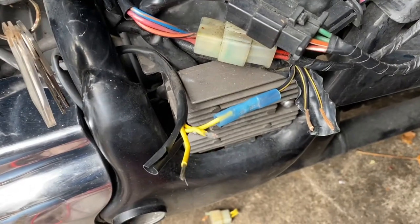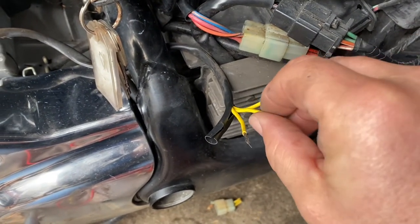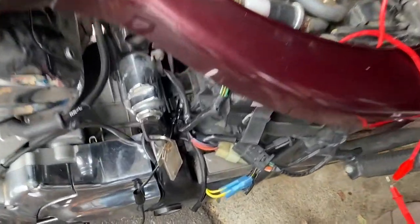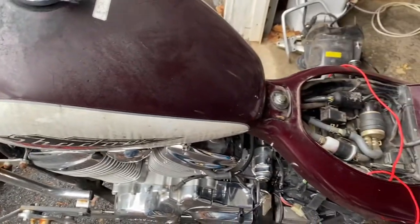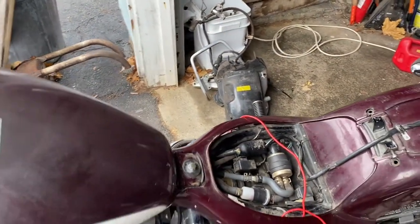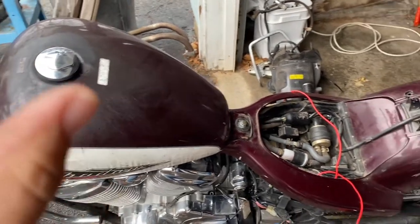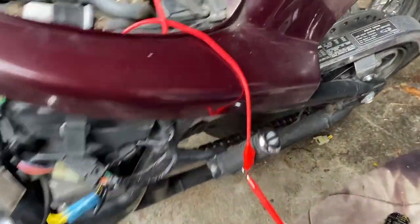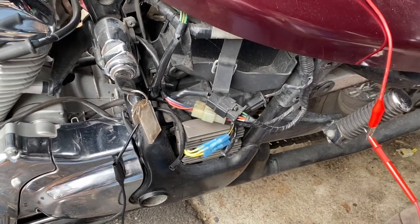We're gonna connect the other two — it doesn't matter which one's which, they all carry the same current if everything's working properly. I got all these guys made up. We definitely still have the carb issue — I'm running some carb cleaner through it to see if it can clear it up, but if it's not going to start without starting fluid we definitely need the idle circuit gone through. It's gonna need a carb clean. I've had to do all these other things too, so let's see what we're doing on the charging system.